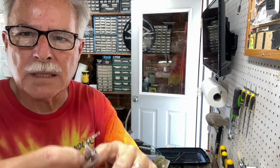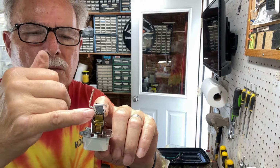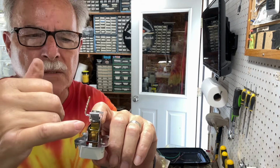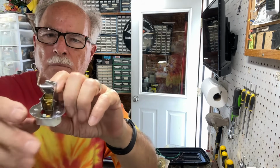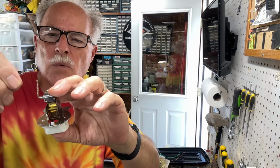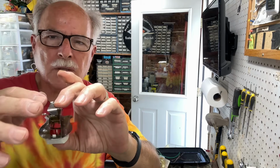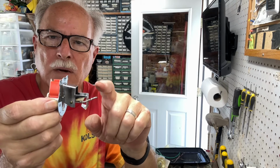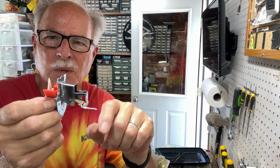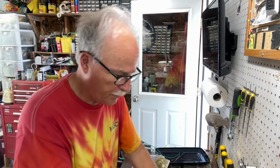This plate in the tulip is brass, and you've got to get it clean, get some flux in there, and then it will solder. Now what John might have to do is tweak these, maybe cut the length, I'm not sure, but they're about as close as I can get them. So now we have a Power Flash tulip with the little wire back on it. So that was a fun experience.